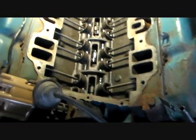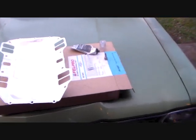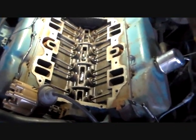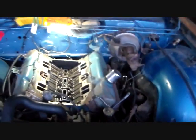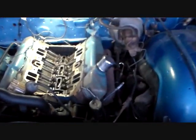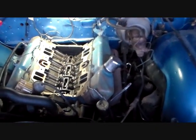The intake on these is a dry intake — it doesn't carry water. Sometimes it can be touchy to get these to seal, but that's actually a good thing, because if it doesn't seal all the way you're not introducing water into the engine accidentally. I've cleaned everything up and the inside of this engine is nearly spotless, so I don't think this engine has very many miles on it. I had anticipated it being rebuilt, the way it looked on the outside.